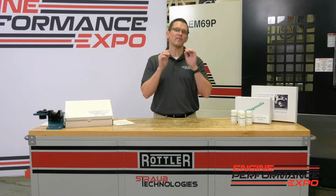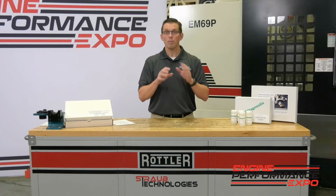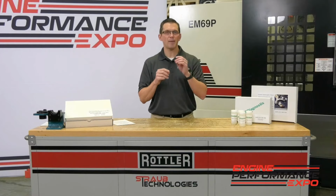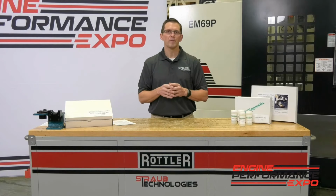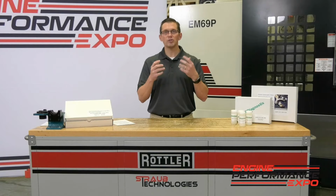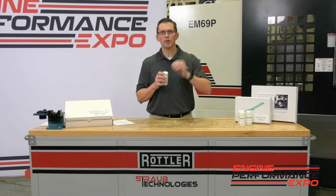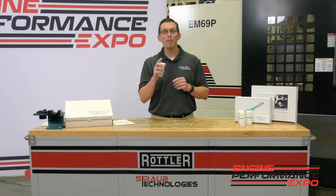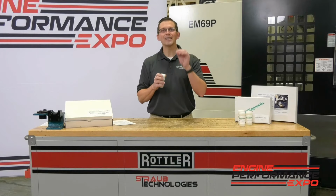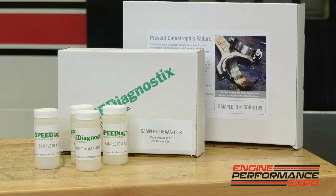Because again, going back to what I said at the very beginning, contamination is the number one reason for engines to fail. More often than not, it's not a parts defect issue, it's contamination. I can tell you from my experience, from working at Joe Gibbs Racing, working at Driven, now working at Total Seal, the number one reason for an engine to be worn out typically is overfueling. So by using the SPEEDiagnostix kit with the gas chromatography, we can determine the exact amount of fuel in your engine. Based on that, we can know whether or not the wear that's occurring in your engine is from overfueling, which means you can extend the life of your engine, which saves you big money just by doing used oil analysis.